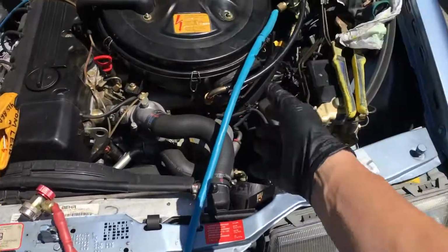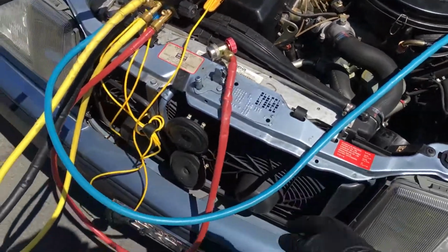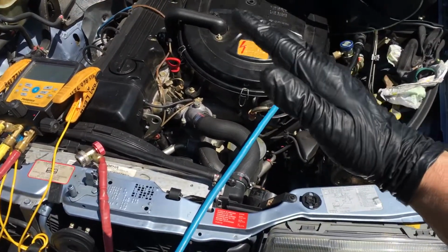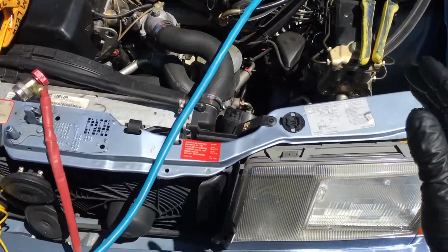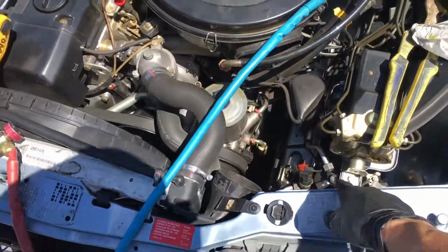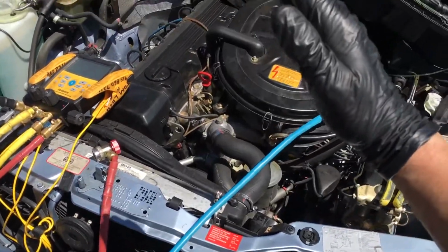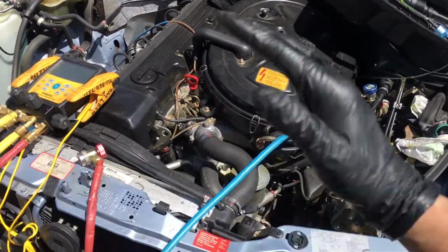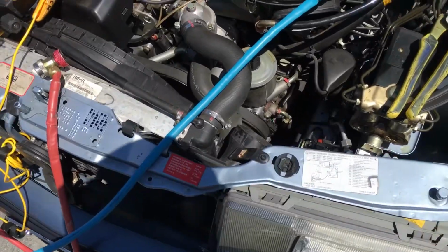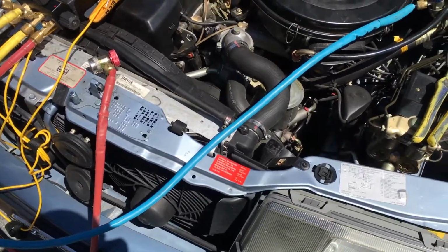Because we just don't want to replace the leaking compressor and O-rings and then send the customer out and then find out the electric fans don't work. This customer has been driving around at like 380, 410 PSI, because I think roughly at 440, this one had the safety switch that'll shut off the compressor. I can't remember. But usually the compressor could be going at 390, 410 PSI all day long, still working, getting some cooling, no fans ever kick on, and the high pressure causes the front shaft seals to leak later on.